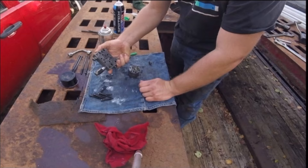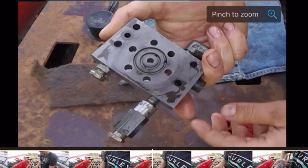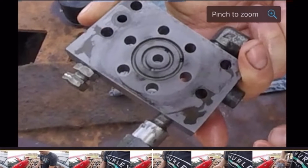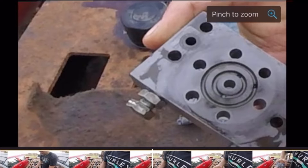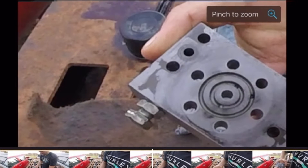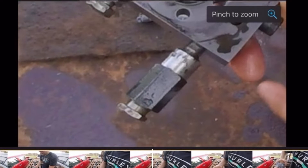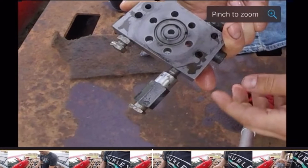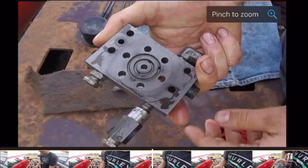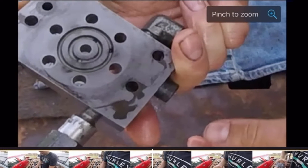This is your high pressure valve body here. The main valve body of the high pressure pump is very simple — there's really nothing to it other than three springs and check balls. This is the low pressure pump pressure setting screw; it's the shortest one on the left-hand side. The high pressure setting is in this big, long piece here — it's got a check ball and a big spring. Make sure your springs aren't broken if you're not getting good pressure. I had broken springs and put spacers in to make the old springs work, since I couldn't find replacement springs for this pump.